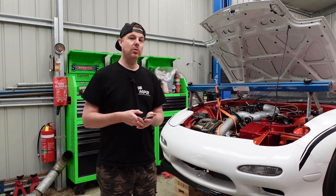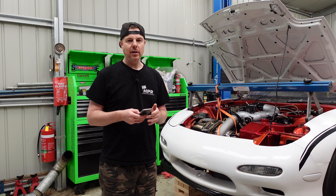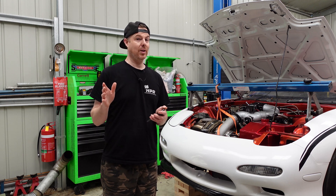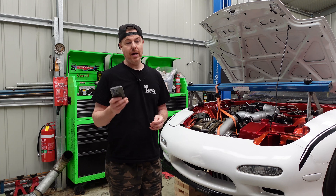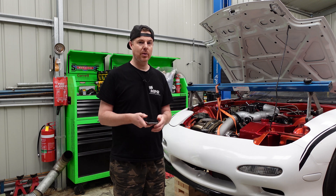We're basically an extra degree above where we should be. But the third and most important one is that the angles should not be greater than three degrees, and really for great performance it should be significantly less than three degrees. So we've got major issues — the front uni is operating at eight degrees and the rear one's operating at six.